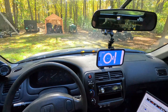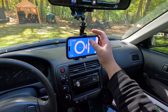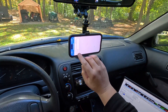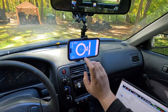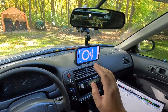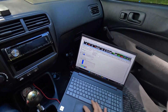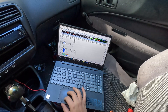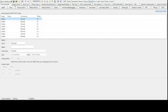Now that we're in the car, we're going to get everything set up. You can see I've got my draggy up here — we went ahead and made a custom one, so we're going to use the custom mode. I've got it set to start at 20 miles an hour and end at 55 miles an hour. If we need to, we can adjust that a little bit later. As for the tune, we're not going to mess with anything at all except for activation and the quick spool.